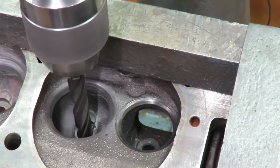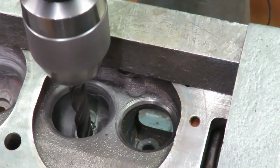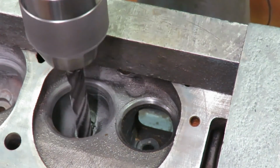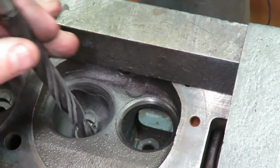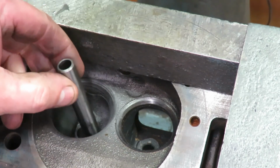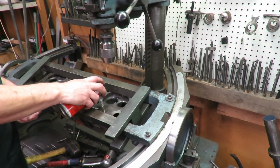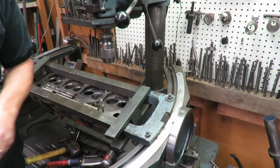With the drill that's going to ream it to size. And that ensures that we're going to get a good press fit. Of course, we'll vacuum all the chips out, but then we're going to drive this guy in here with our driver. So then we just take some spray, some special spray oil. This stuff's made by Sun, and it's pretty good. It sticks to the guide. It's made for putting press fit stuff together.